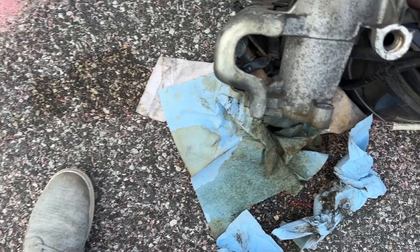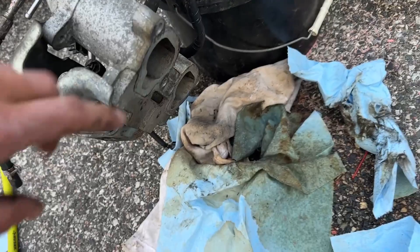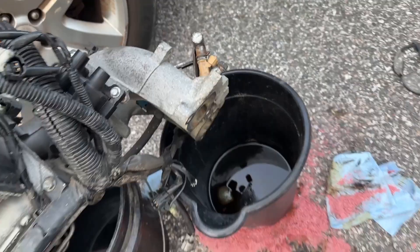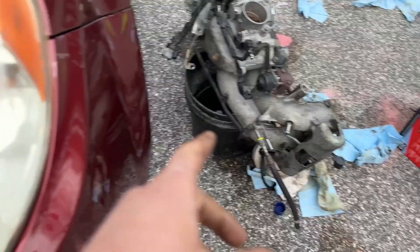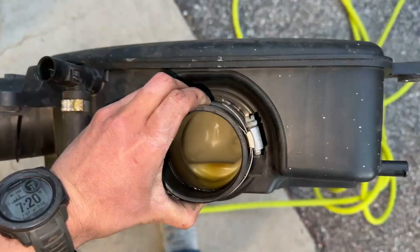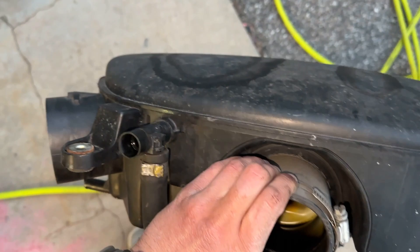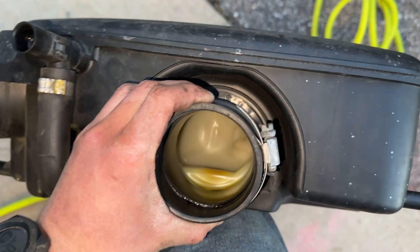Got the gaskets out — four bolts per connection, eight total. Injectors are re-bolted in. Colby just rolled up to help. We're going to land the intake on the gaskets and torque it down with the eight bolts. My plastic air intake housing is a little dirty on top but I wiped out all the oil on the inside. I'm going to throw that back on too — it attaches onto the back of the intake manifold. Make sure it's dry before putting it on, and use the air compressor to clear out any remaining cleaner.